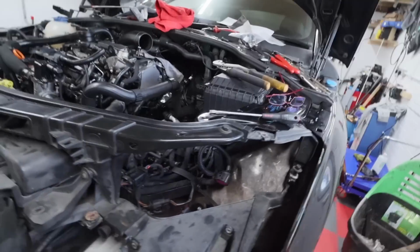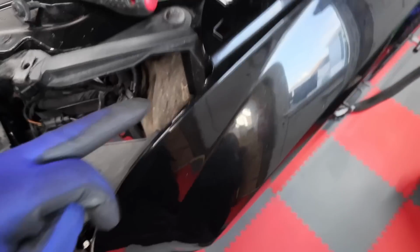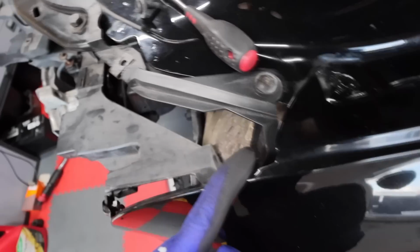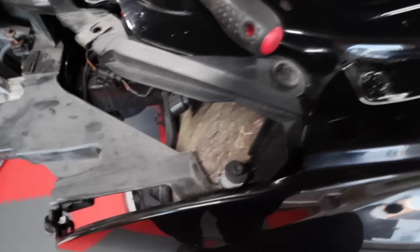Right, what's next? Headlamps. Let's get the headlamps in. Okay, so the headlights on the TTs are really simple. They're held in by 3 bolts, one here at the back, and then one here at the top. Now to get to the back one, you basically just drive an extension down to the little corner that will be available. We might have to use a screwdriver though, a Torx 30 driver. So we'll have that prepared, but it should literally take a couple of minutes to get it in, and then of course we have our power connector right there.